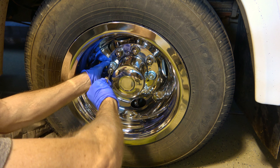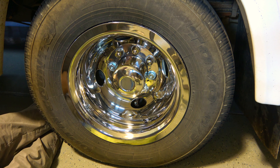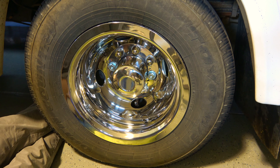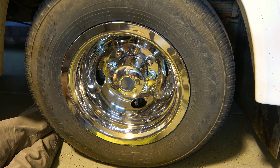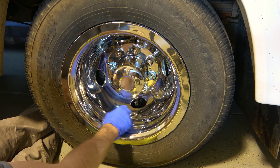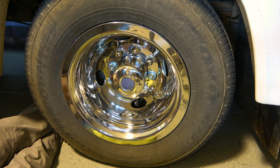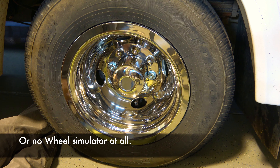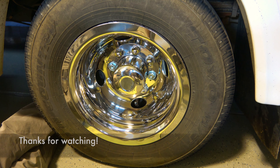Then just like you would normally, I'm going to grab a rubber mallet to get that on there. So you've got your extenders on there and your snap ring on there. Now on the other side, what I did is put this washer with a little relief ground on it — just enough clearance — and then put on a nylon lock nut, which I had to buy separately.